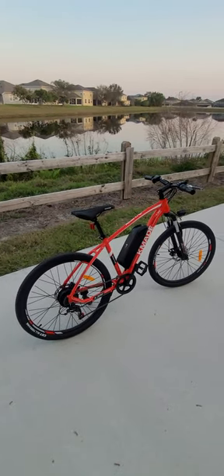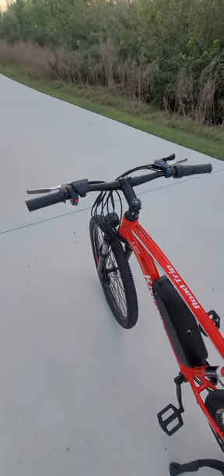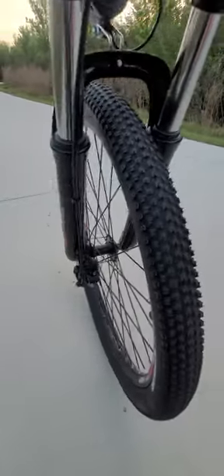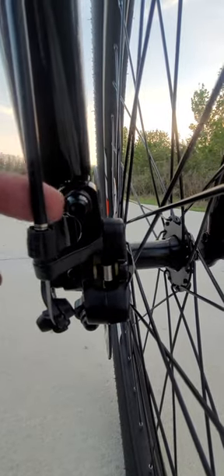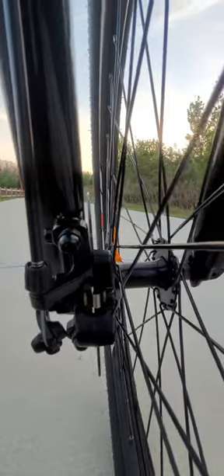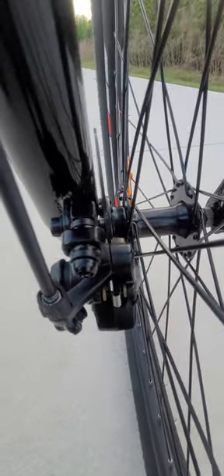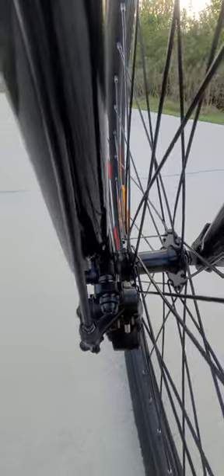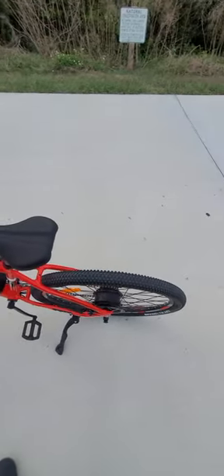This is a continuation on my video about this bicycle. I want to clarify something I mentioned — I said I was having issues with the front brake. It actually needs to be adjusted from here with this tool. You have to unscrew it and push it a little bit away from the disc, so you fine tune it to prevent the disc from rubbing against the braking pads.